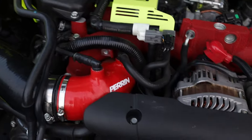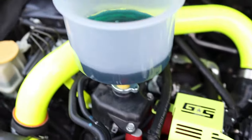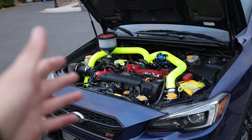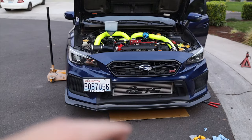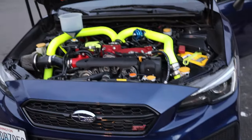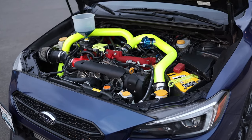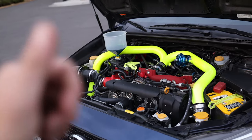While you're waiting, don't forget to massage the hoses to get any air pockets out. I removed the no-spill kit briefly, then I'm running the car again to get all the air bubbles out completely. I also jacked up one side to make it level, and I removed the clamp off the cylinder 4 cooling mod, which caused more bubbles to come out. Keep going until no bubbles appear for about 10 minutes and all temps look good.